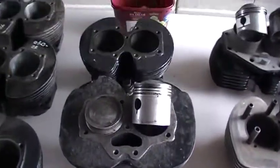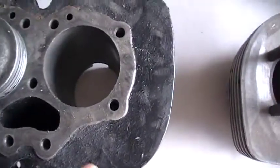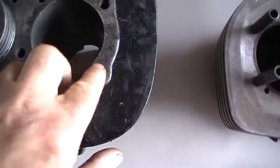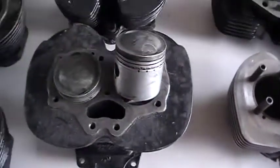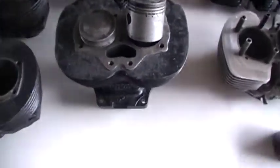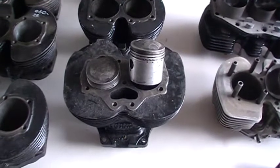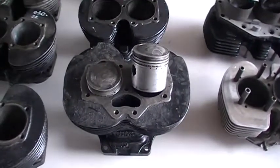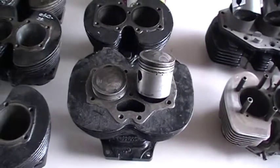Here I've also got an A10. You wouldn't think it would be a problem because when you look at the bolt hole pattern it's quite wide out to the bore, so that's not usually a problem. But what is a problem with A10s and most BSAs is it's a gear pump and they tend to wet sump. That wet sumping is a bit of a problem on start-up and it'll smoke like buggery.